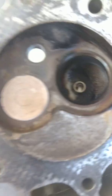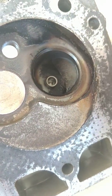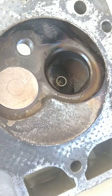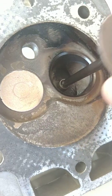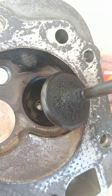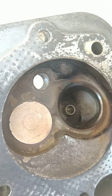You can actually see it in here if the lighting's right — you can see the burn marks, and the oil's been burned. They'll start backfiring and shooting flames back into the fuel system, which is quite dangerous. This face has to be really smooth and mate right against the surface you see here. The oil burned onto the valve happens a little over time — about half an ounce per hour gets burned — but this was exceptional because the guide down inside, that piece is sloppy and worn out from the heat. There's a lot of play in there, allowing oil to drip down through the valve, causing carbon — what diamonds are made out of — to get smashed between the smooth surface of the valve and the smooth surface of the seat. Once that happens it deforms the metal, it doesn't seal anymore, and you wind up with backfiring and stuttering of the engine.